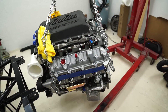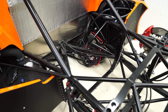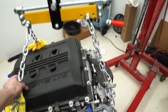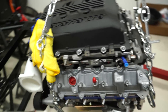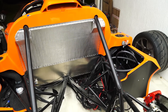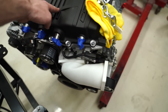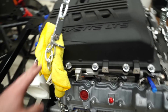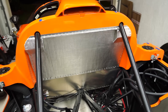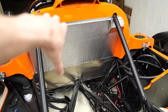I need to get that measured, then pull the engine, then finalize my fuel lines and coolant lines. As you saw in the other videos, the radiator lines come from the front of the car and run all the way down the side — there are just open pipes and intercooler lines sitting there, so all that needs to be finalized before the final engine fit. We're set up and ready to go — dropping it down into the engine cradle, sitting on a Harbor Freight low leveler, with everything protected. The front of the engine, from the alternator to the pulley, is about an inch to an inch and a half wider than those two roll cage bars.